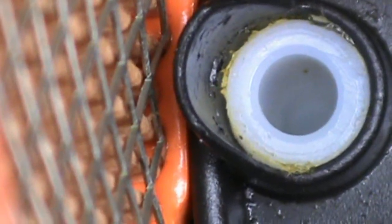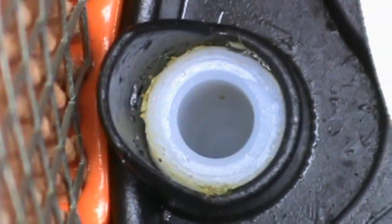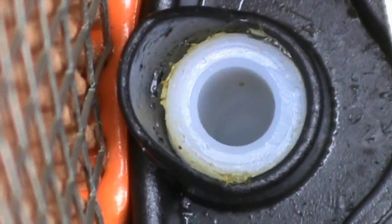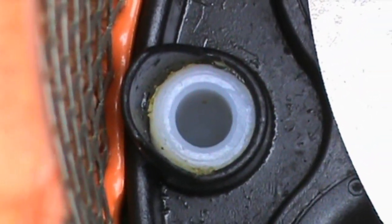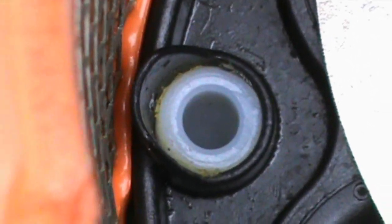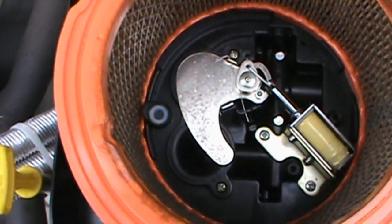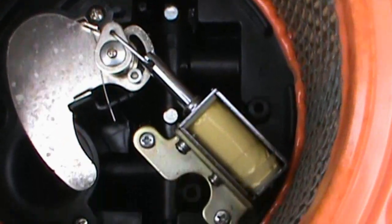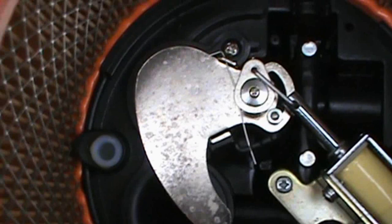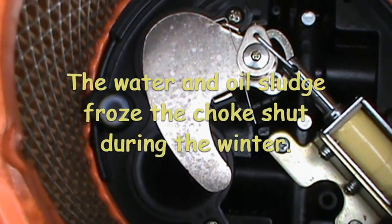That hole — that's a little elbow that I have glued in there now. I couldn't quite get one that was tight enough the way I really would have liked, so I had to glue it in there. But that used to be a little black straight plastic tube that connected to a rubber vacuum tube that went right down into the crankcase. And when this thing would run, it would just suck moisture and oil mixed together, and it would dump down inside these little recesses in the carburetor housing. One time it built up so heavily on this choke plate that it froze it in place and the unit wouldn't even start.